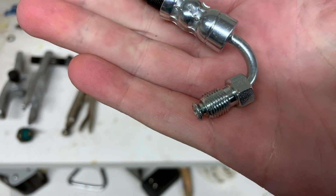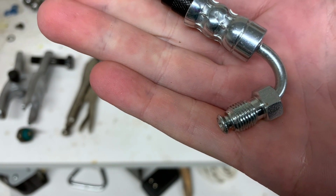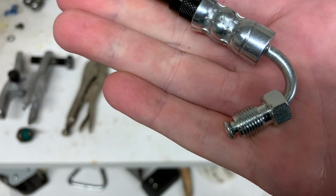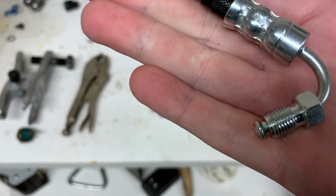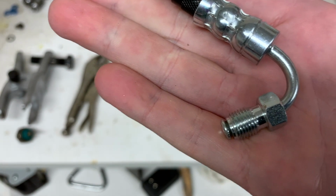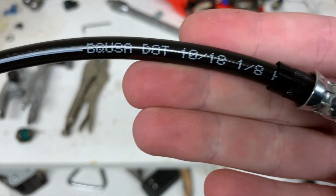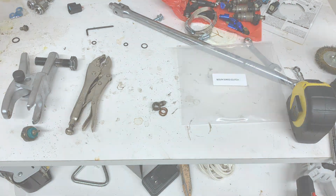So the other option is an M12 by 1.0. If you don't have the correct size bolt, it's usually a 12 millimeter head, but I would definitely check it before I just mistakenly ordered the wrong thing. Apparently they're only common in Canadian models, but they're listed as like an F and H series part. So I guess it was more common on like the Prelude Accord chassis. But so overall, very pleased with all the help from Jeff here. So we'll go ahead and switch the camera over and we'll get to putting it in the car.